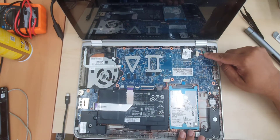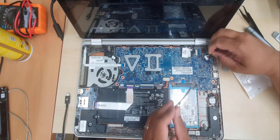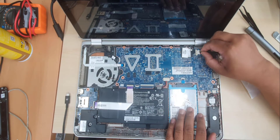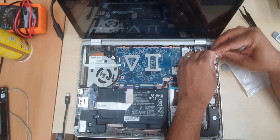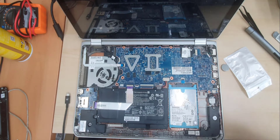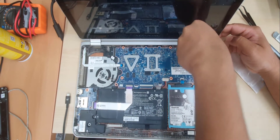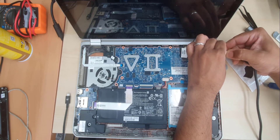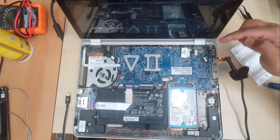First, what we're going to do is test the actual charging port flex connector. Simply take out the old connector — disconnect it — and then plug in the new one straight away. Then we're going to plug in the charger and check if this connector charges the actual battery, to confirm what's going on. The actual size is fine, but there are some issues on the side that I need to flatten. So I'm going to make it flat and put it in. It's connected now. Let's connect the charger — if there's an amber light, we can confirm the charging port was faulty. It's absolutely fine now, we are good to go. We confirmed that the charging port was broken.